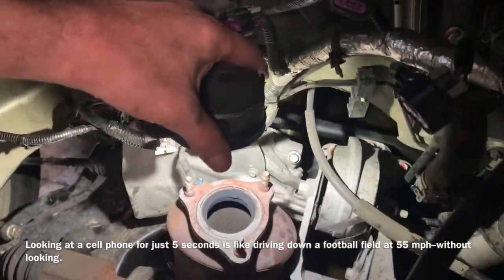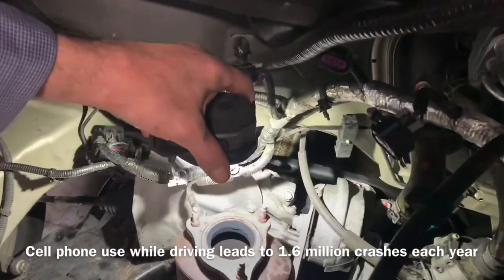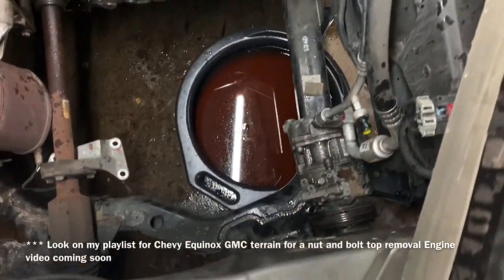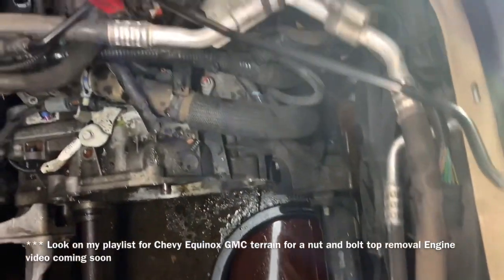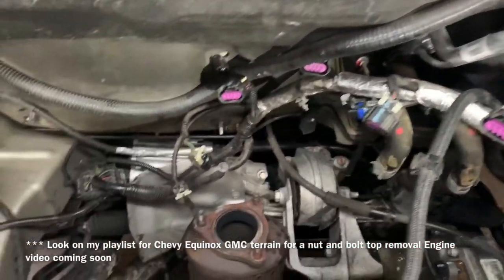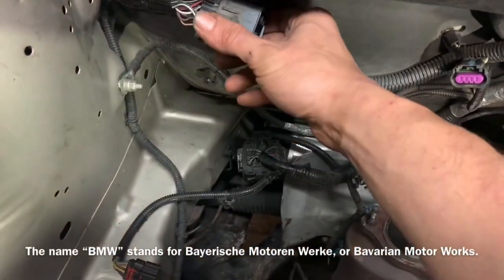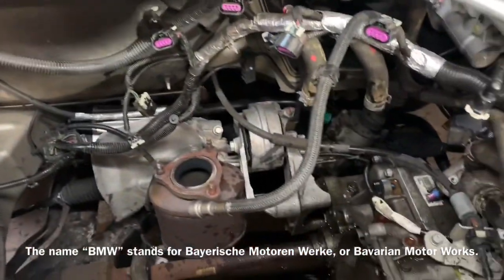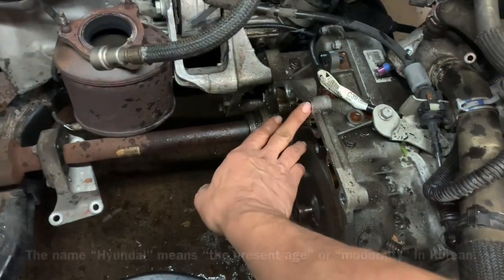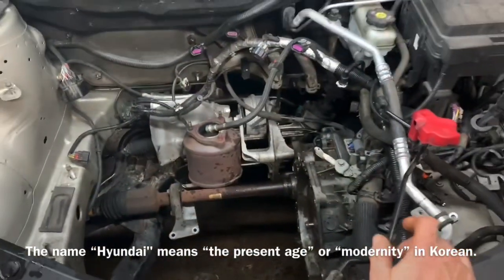Frank is going to show us to make sure we look down inside the catalytic converter after removing the engine to check that the honeycombs aren't bad. These are known for the converter to be bad, but that one's good — you can see the honeycombs are in good shape. After we've gotten the motor out, you can see that most of the electrical is disconnected. We left the electrical connected to the power steering. Don't forget about the ground wire — they didn't even take it off so you don't have to worry about re-hooking that. The blind bolt up here is the one that's hard to see; as long as you get all of them out, you should be successful in removing the engine.